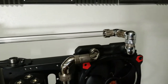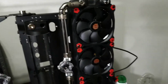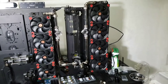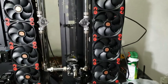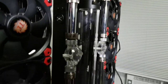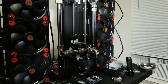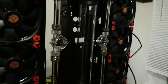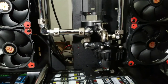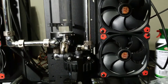Then this goes into the second acrylic run, a couple more 90s and extensions, into the second 560 millimeter radiator on this side. Another flow indicator as you can see there, and into another 400 millimeter reservoir. Then we've got a second D5 pump, and another drain.